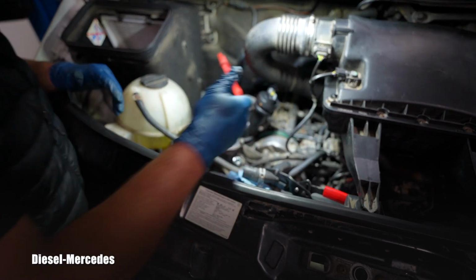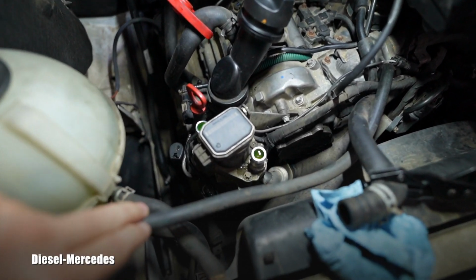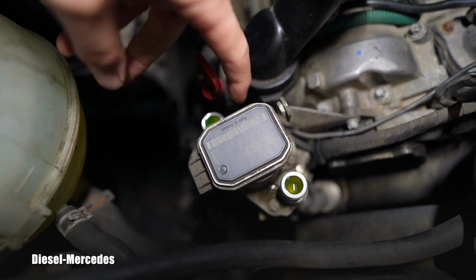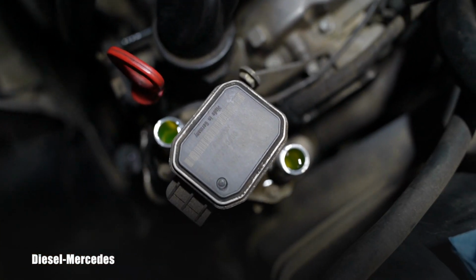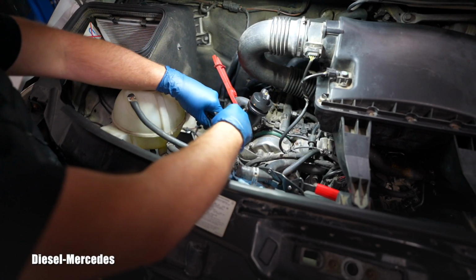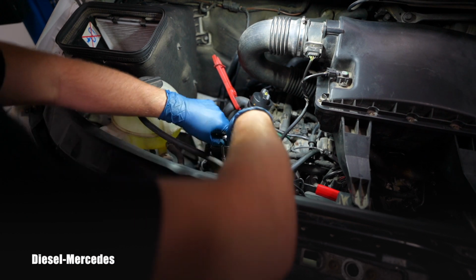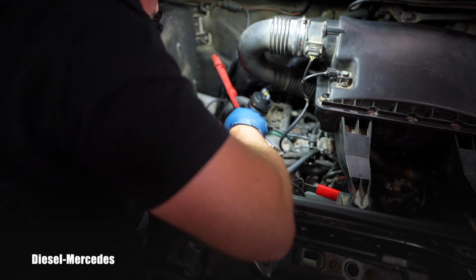I will show you that new detail. I will always try to zoom on it for you, but this is the 20mm prime lens, so I'm stuck on the tripod, but I will keep showing you. So you remember these 4 E10s? This is how I will continue right now, and that should help us lift this EGR valve upwards. Let's see how tight these are. That's totally normal torque, nothing excessive. Oh yeah, they are coming loose really easy, so nobody should have any problem with removing this.